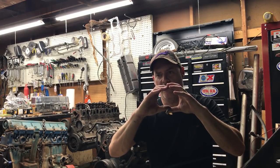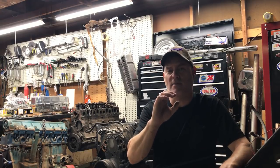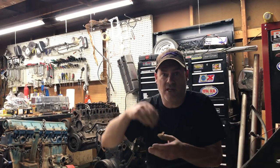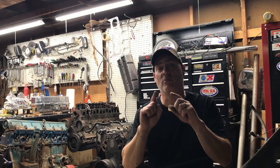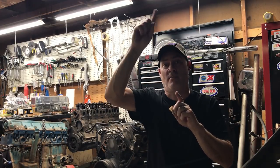Of course, it has a larger cam. The cam has a much bigger base on it. If you have a larger base on the cam, you can have a much more aggressive cam profile but it's more gentle. Whereas the old small block Chevy cams with their small cam diameter — you could have a really aggressive cam, but it was so aggressive that it would just beat the valve train to death, slamming it open and slamming it closed. With a bigger LS roller cam, we can have a really aggressive profile that's a lot more gentle because it has more time — it's not slamming open and slamming closed. So we can have really super aggressive cam profiles on the LS and it's actually very gentle on the valve train.